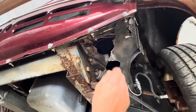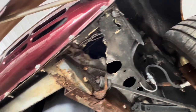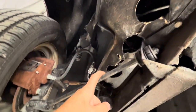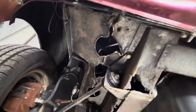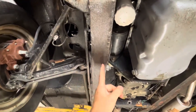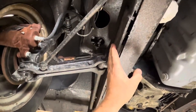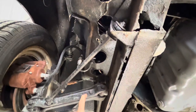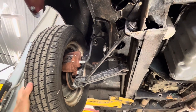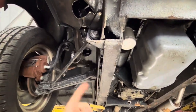Now the front here we got some problems. This isn't from rust — somebody's cut that — and the other side is actually worse. There's been some damage at some point, maybe from an accident, so yeah that's not too nice. This repair here was done a long time ago. We've got an angle iron here and a piece of flat bar here. This flat bar being here is going to push out the bottom and give this some negative camber. Negative camber is not necessarily too bad, but you don't want a bunch of negative on this side and nothing on that side.